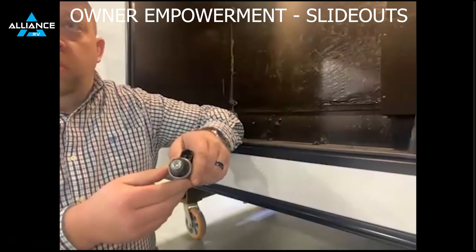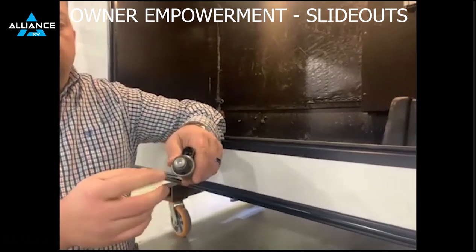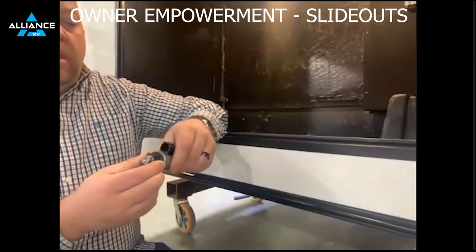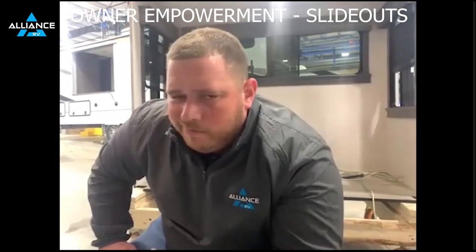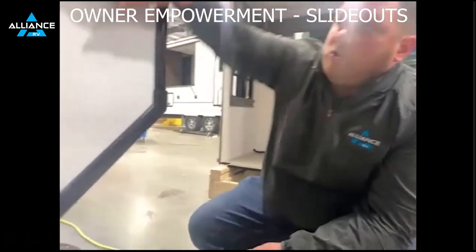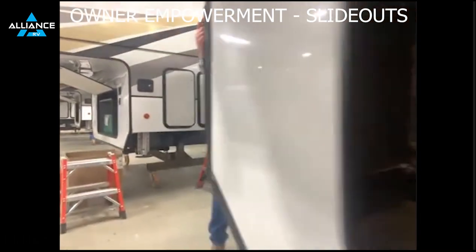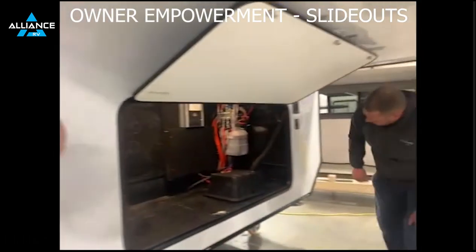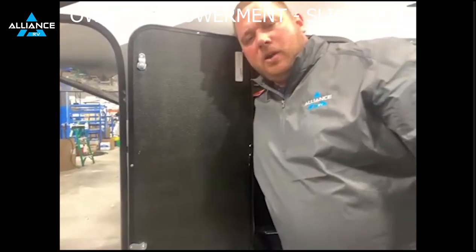So that's your simple fix. If you're seeing bleed-through — put down your leveling gear and your slide comes out — that's one of your first steps. A couple of small turns with a 5/32" Allen wrench on these solenoids. Just snug — you don't want to overtighten; you could damage those pretty easily. Just turn to where you feel the resistance, back off, let it go, and that usually fixes the problem. You also have one always attached to your off-door side leg — it'll be very hard to see, usually buried up in the compartment, but if you reach in you can feel it and get a 5/32" Allen wrench on there. It's exactly the same valve, different location — a total of five that you're going to deal with.